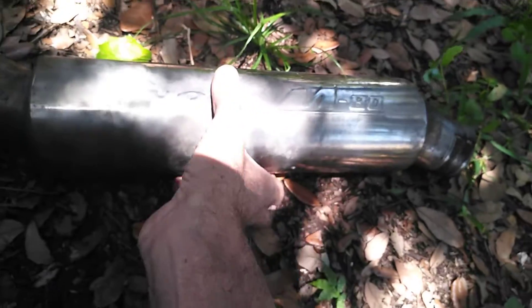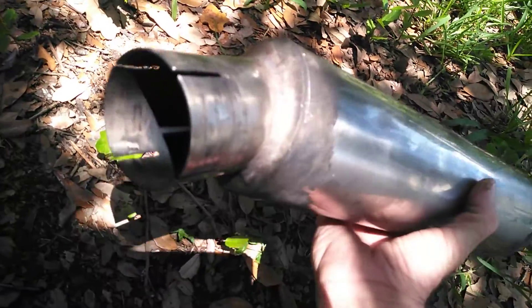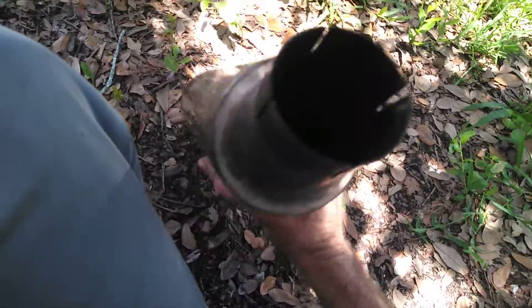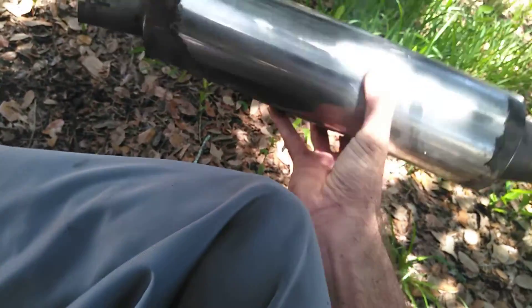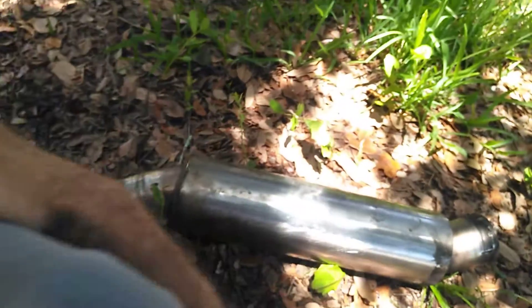This is the Pipes M80. It has no kind of damage on it, as you can see — just a little dirty. But listen: the welds have come loose on the baffle on the inside of the muffler, and that was the noise I was hearing on the exhaust.